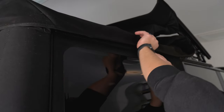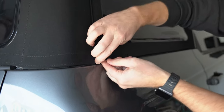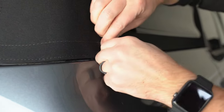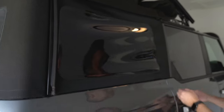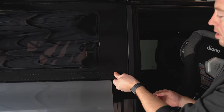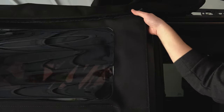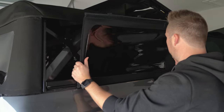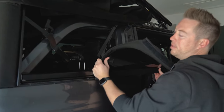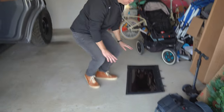So this panel is belted on. We're going to undo the velcro and then release these buckles — there are three of them. Once that's done we're going to pull on this little piece right here and this tab is going to slide out of the slot. Just kind of work it up, then open the door so you can reach in and pull this tab out of the slot. Now it's released and you're going to slide this out toward the front of the vehicle along the track. Now that panel's off — lay that down in a flat area so it doesn't crease.